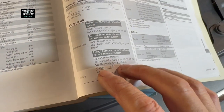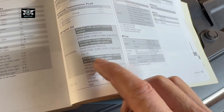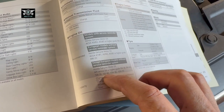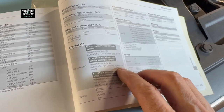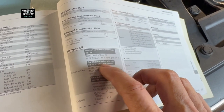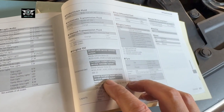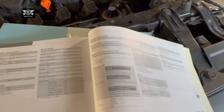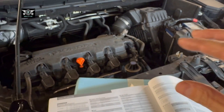There are other oil specifications you can use here: 5W-30, 5W-40. It does say except European models without service reminder, or European models with service reminder. It's all giving you 0W-20. I normally use 5W-30 because it appears that 0W-20 tends to form a lot of carbon.